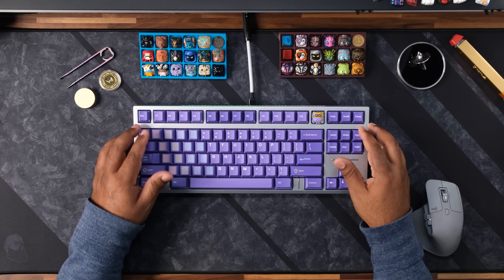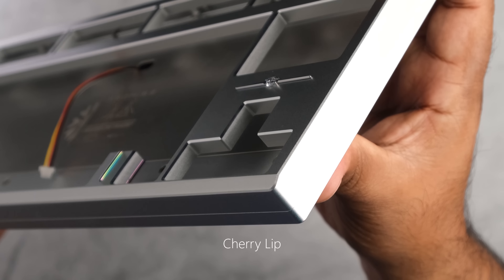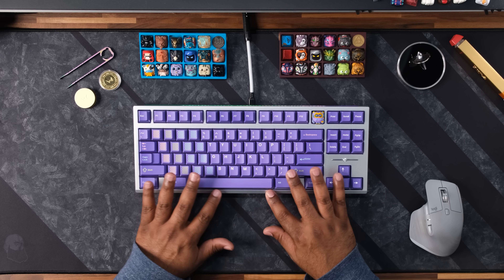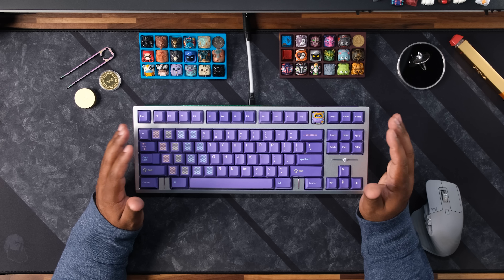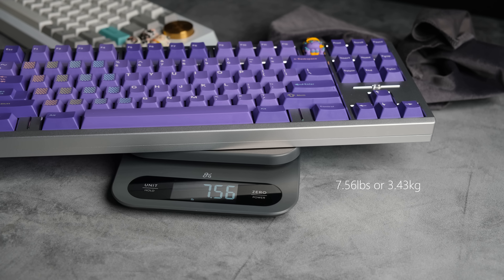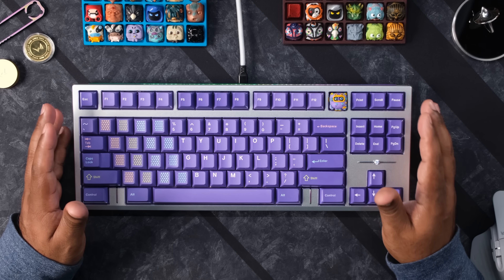I love the slight additional space Wuche added between the F-row and the alphas. The front of the keyboard is slightly tapered down, which is also known as a cherry lip — a really nice touch that gives it a comfortable feel when typing. The front height is around 19 millimeters and the typing angle is 5 degrees. Fully built, this thing weighs as much as a newborn baby, coming in at 7.56 pounds or 3.43 kg. Yeah, it's a heavy boy.